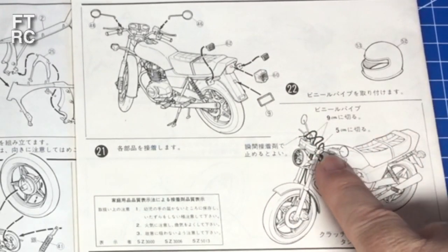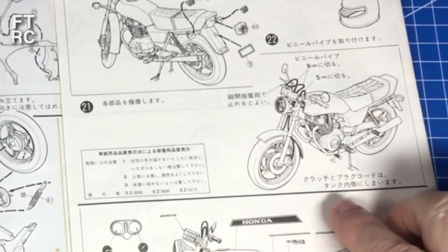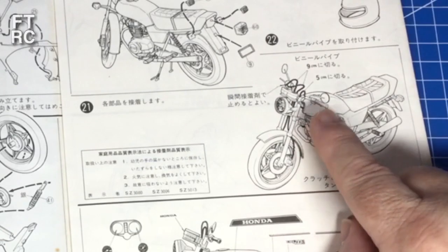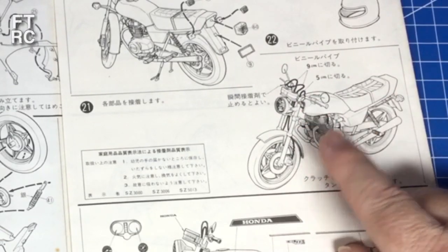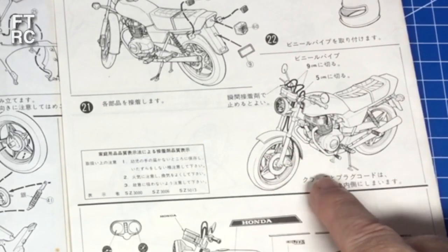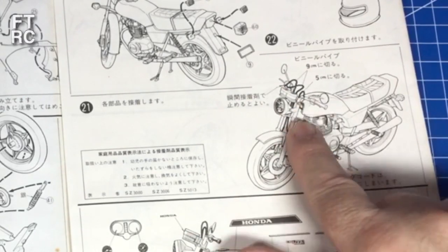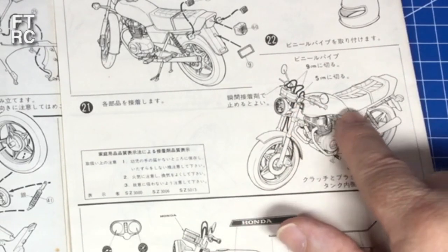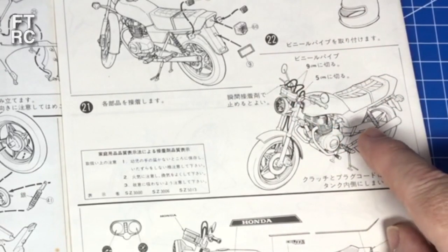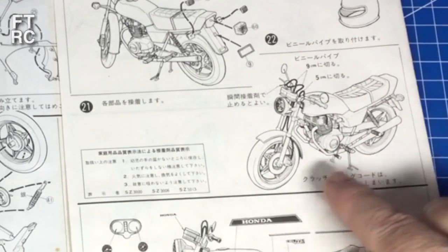Now, strictly speaking, at least the kits that I've seen down under, they don't go like that. They don't all stick up in the air and go round and round in circles. So when I eventually got around to doing the brake lines for Bask, I did them as per photos I'd found and how I remember bikes. Although, strictly speaking, they've got a left and a right here for the front brakes. It's dual discs on this bike, which is pretty good, which should all go up and only go to one side. And then on the other side, you should have a lead running round underneath the tank, which is basically for your clutch, because your clutch is on the left, and the right lever is for your front brake, and your rear brake gets pushed down by a brake pedal, which we put on somewhere back there, I forget where.